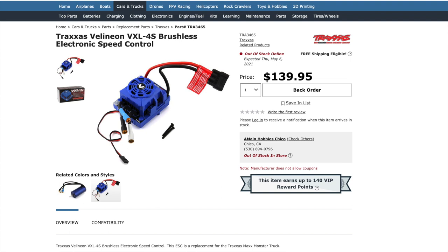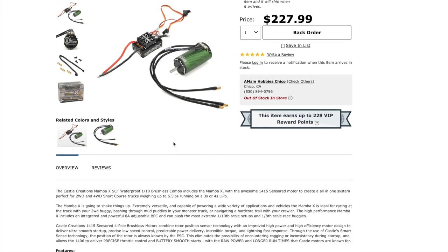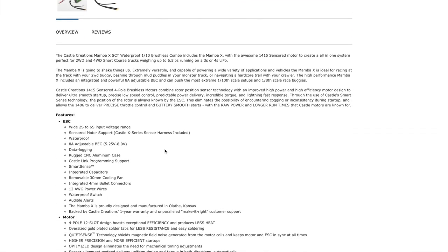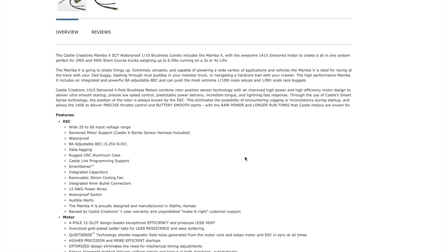If you didn't want to go with this, you can usually get take-off motors for a pretty good price — so shop around. But something else: for $230 to $280, you can get a Castle system. If you're a Castle fan, this is 2,400 KV and I believe it's also a 70mm can, which to be honest is a lot longer than you need for this type of vehicle — about 69.5mm, almost 70.